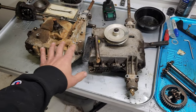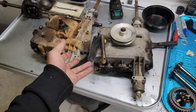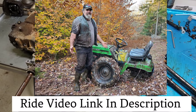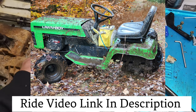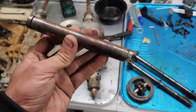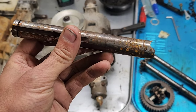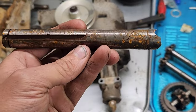This is a phenomenon I have hoped for years that I would actually have both in my shop at the same time in order to show people. Older Peerless axles are prone to snapping. As you can see, that spiral right there goes around the entire thing until it hits this keyway.